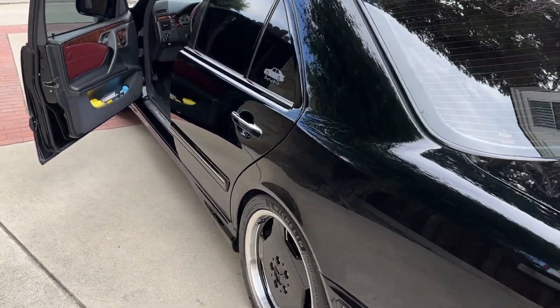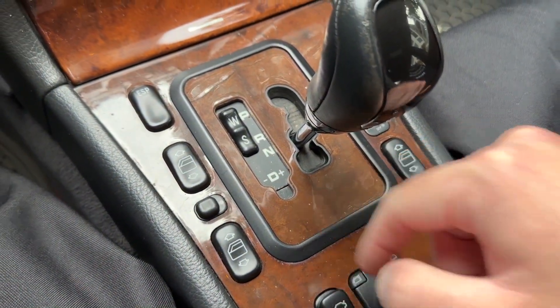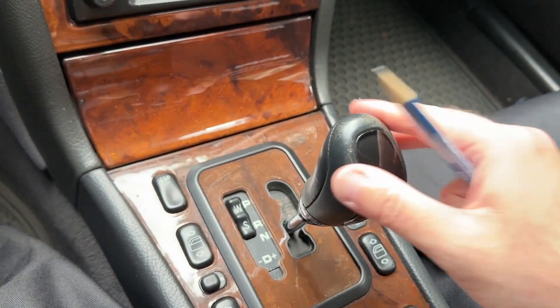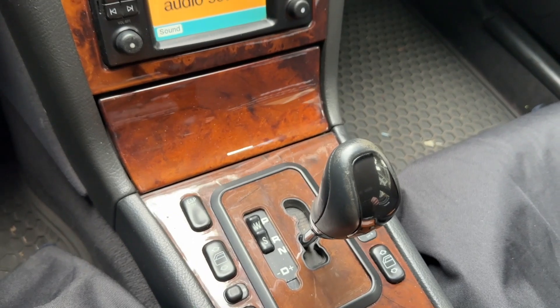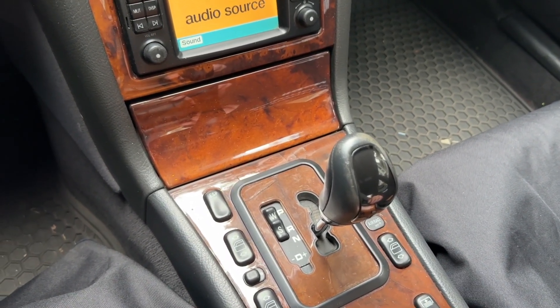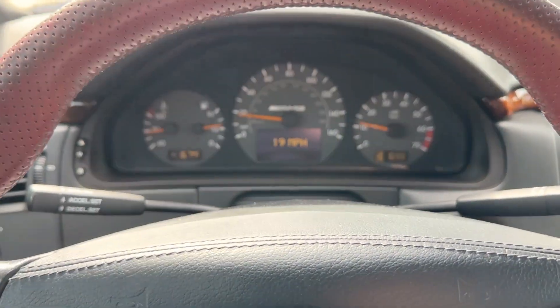The way you get this car in gear when it's stuck with the brake light switch: there's a little access tab right here - you stick a pencil in it all the way down, there's a little button that releases the shifter. That's how you can drive your car if your brake light switch has failed. Unfortunately my brake lights are on so I look like an idiot, but at least I can move around.